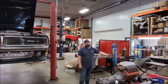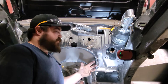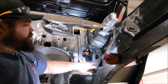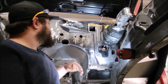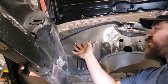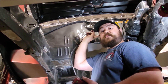We've got the motor, trans, and front suspension out of the car. Let's take a look in the engine bay and see what we've got to accomplish. Here you can see from putting in our modern tunnel, we still have a rough edge — we couldn't really finish that before because the motor was in the way. Now we want to get rid of where the steering column came through and add a custom piece. We're going to fill in all of this, get rid of all these weld nuts, fill in these holes, and any other holes you see here. Over on this side there's been some smoothing done by a previous person, so we want to make sure the work is up to our quality. Let's start finishing our edge, remove some of this paint, and see what's under it so we can start getting ready to fill some holes.